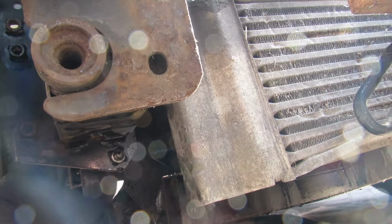And there's this seal here as well. So that needs to come away. So what we need to do here is give this a really good clean, now, put the seal on, bolt it back on. Don't use sandpaper on that. Just use something like a green or a brown. Emery. No, not emery. Like a scotchy pad, with a bit of soap and things, whatever.